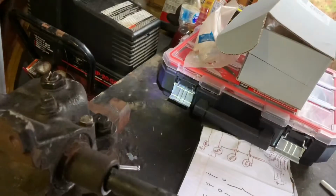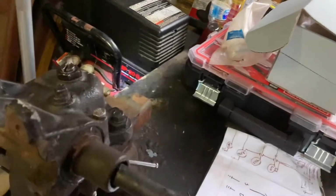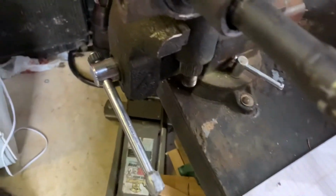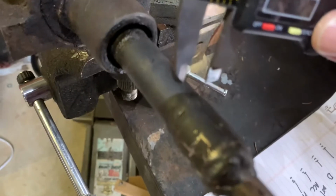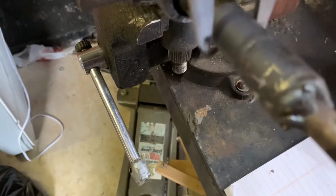All right, now. So 1 inch 44 splined on that, and on the steering box. Oop, my fingers were in the way. Oh, it's still zeroed. I'm going to cut this steering shaft probably right about there. Oh, now you can see, right about there. Because the rest of it's just all boogered up, as you can tell. So I'm pretty sure this is 3/4 round.